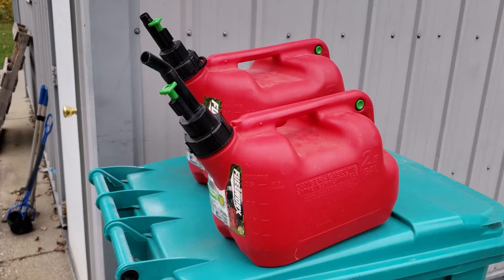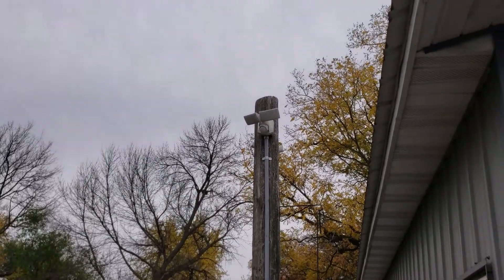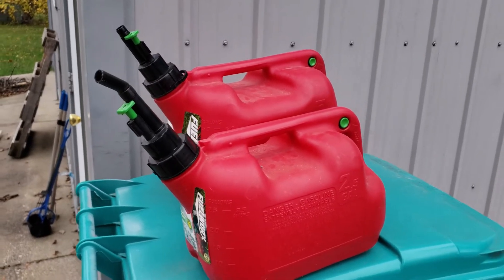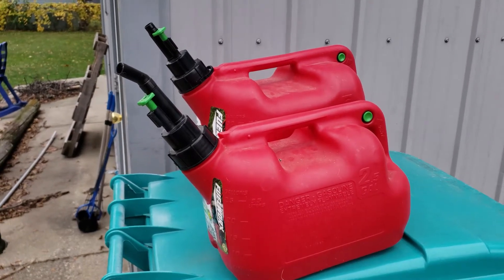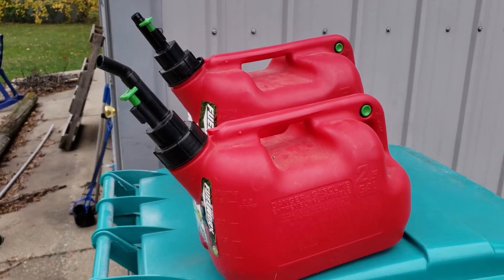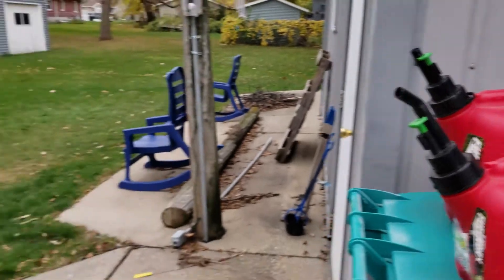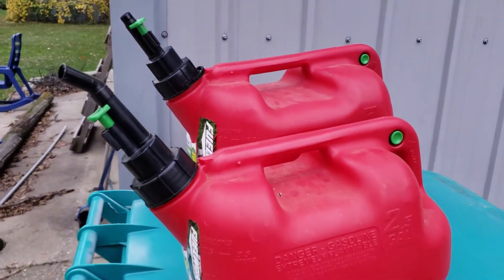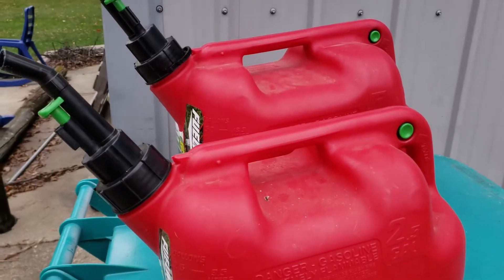Hey there YouTube, welcome to Big Mike Beard Wisdom. It's going to be winter time — leaves are falling, sky's looking gray, it's chilly. Now's a good time to start transitioning stuff like the lawnmower over to storage mode. I don't do a whole lot for my lawnmower, but what I do is essentially add a little bit of fuel stabilizer into the cans, and then this may be the last time I mow the lawn for a while, so it'll get a nice tank of stabilized fuel that'll hopefully work all the way through the carburetor.